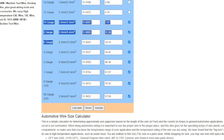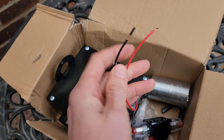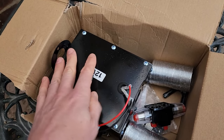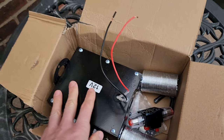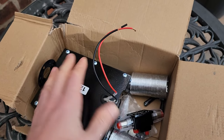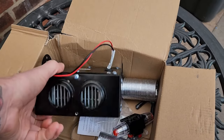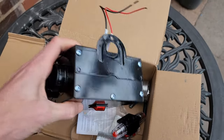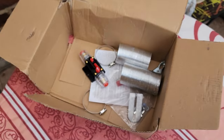So we've calculated that 10 gauge or 8 gauge wiring is appropriate for this circuit with a 35 amp fuse. But why does this heater have 14 gauge wire coming from the housing - a lot smaller? That doesn't make sense. Is it going to overheat, cause a fire? Using a wiring calculator for 14 gauge wire, you'd typically use a 15 amp fuse to protect the circuit. Remember at the start when I talked about the cigarette adapter with a 15 amp fuse? Do I just have an overpowered cigarette adapter heater without even the adapter on the end? I'm going to take this heater apart and see what's going on.